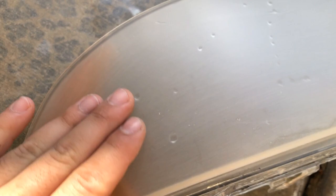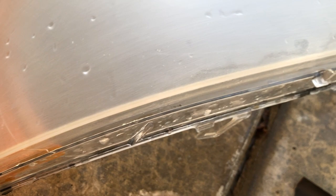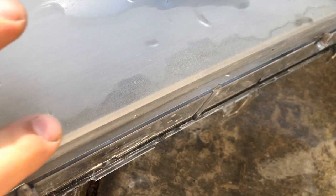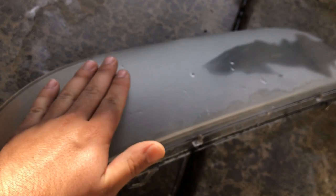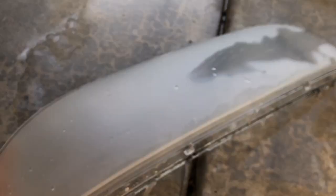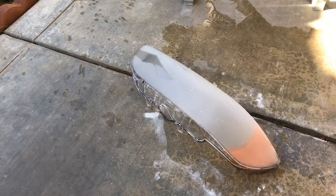Let me show you the progress. If we zoom into this lens, you might see the scuff marks going in a pattern like this and then the opposite — that's what you ideally want to do. If not, I kind of just go in a straight pattern, doing it evenly along the whole headlight. If I zoom in, you can see that for the most part all the oxidation is actually gone. But on the bottom you can still see the other part going a little deeper. So we want to get rid of these marks because this part was a little deeper in the lens. In the beginning when you're scuffing, it's kind of a yellowish goo that comes off — the more you scuff, the more it turns white. That's a good sign. So now just this bottom part I'm going to try to get rid of, going a little deeper. I've been using 600 — I'm going to try 400 to get this out a little quicker.